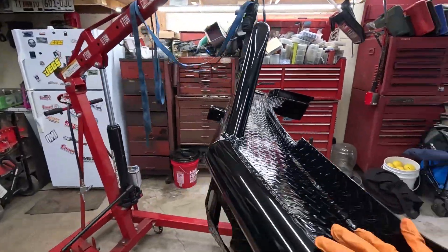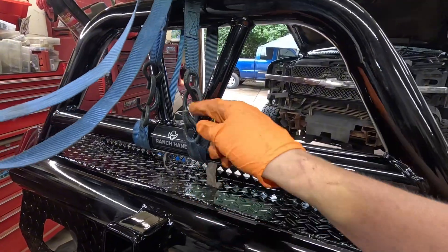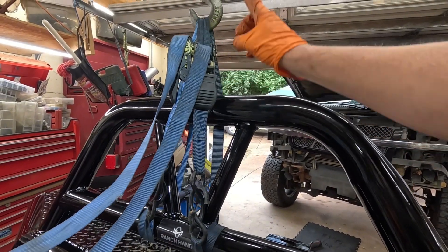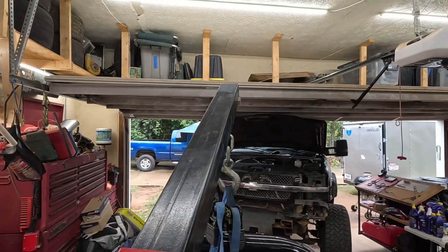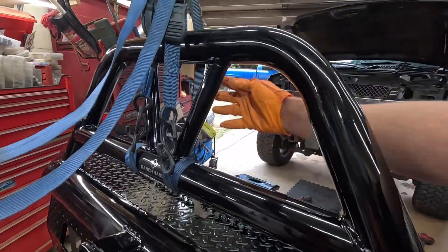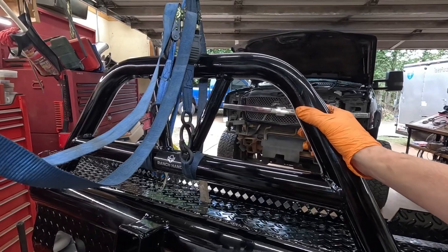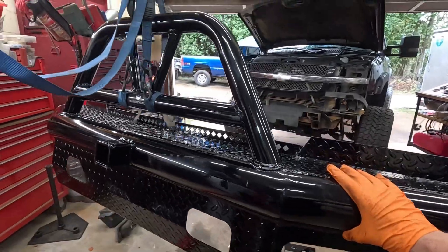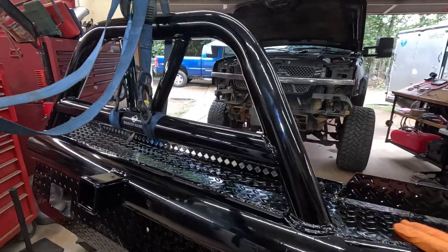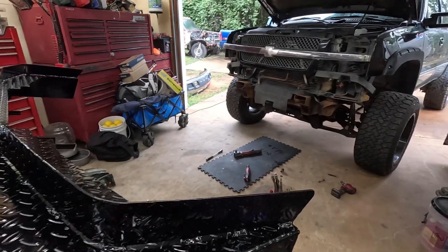We got it in the air — let me show you how I did the rigging. These are some Harbor Freight straps. I wrapped them on the bottom because I needed my hooks to stay as low as possible so I could ratchet the straps as close to the hook as I could, since I'm starting to worry about hitting the garage door. I wrapped them and looped on each side so I have two straps — I don't want to break one since this thing is heavy. The separation also gives me some side-to-side balance, and it's leaning back just slightly which should work as we bring it to the front of the truck.